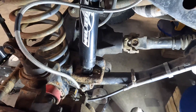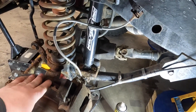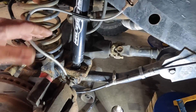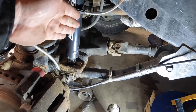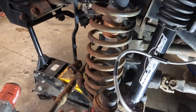As I mentioned before, you may or may not need to remove the bolts of the front shock. The reason why I did it is when I go to drop the axle, if by chance the stop hits in the shock and I need that extra little push, I won't have it. This way, if I need to push the axle down farther, the shock will stop at its maximum travel and I can still push the axle down to wiggle the spring out.